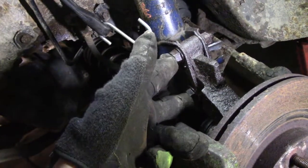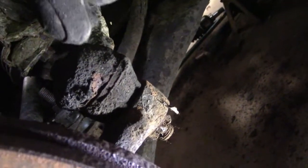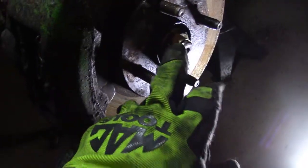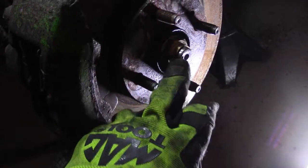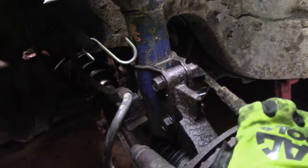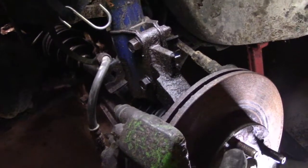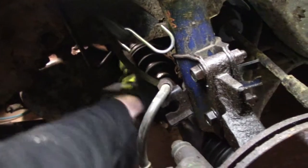I'll be removing these two 17mm bolts — the spindle away from the strut. There's a cotter pin and castle nut on the outer tie rod end that I'll be taking apart too, knocking the outer tie rod away from the knuckle. The axle bolt — I think it's a 32mm — is usually a one-time-use bolt; you have to pinch them to lock them in place. Remove that, knock the axle through. Once you move these two bolts and the outer tie rod, the whole knuckle will swivel down and you can actually access and remove the axle from the spindle. Then I'll show you how to pop it out from the transmission side.